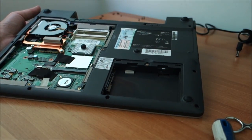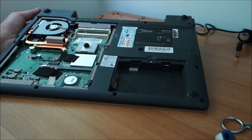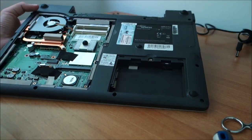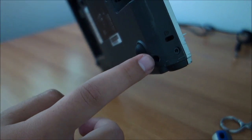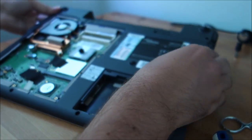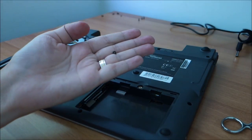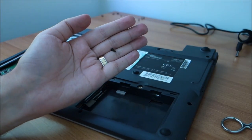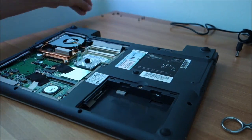Next, you can put the screws all around the back, these ones, up until here. Do not put in this and these two. Do not put them in. They are for the hinges, also in this corner, one here and one underneath. All the others around the edge you can put them in, and they are of this type, black ones, longer. Only one longer black type is in this laptop, so you cannot put them wrong.